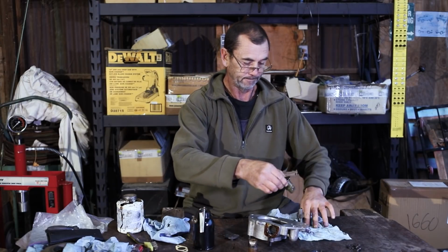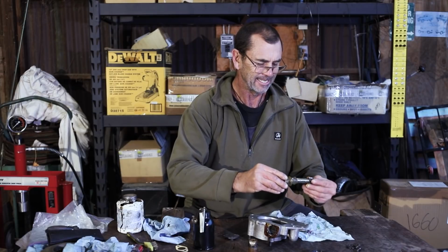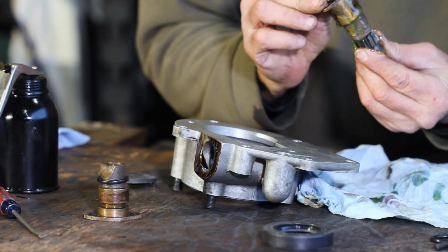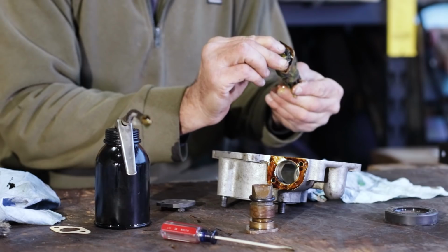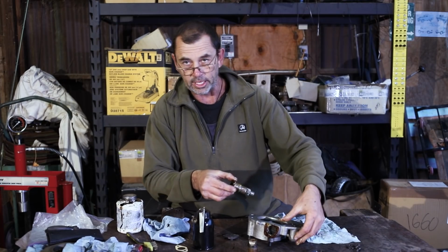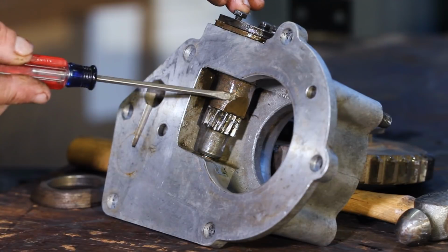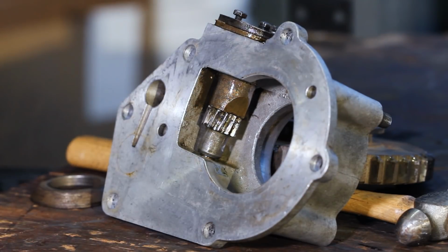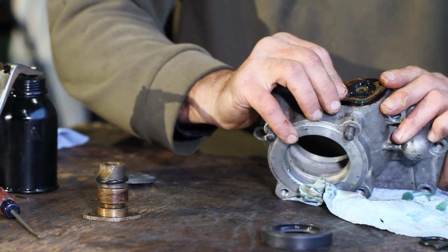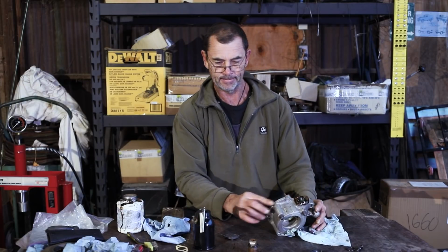Okay. Pinion goes inside. It's meant to. Press it up to that seal. Then when we lob it in the hole, we have to make sure that this chamfered section here is facing where the speedo worm will be. That's the idea. There we are. Looks good so far.